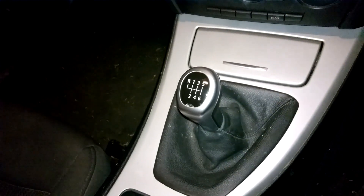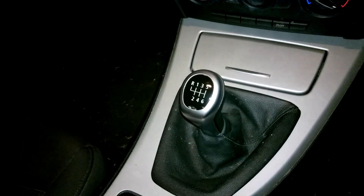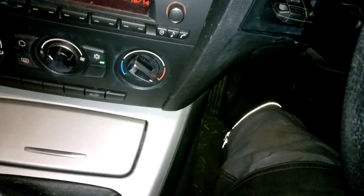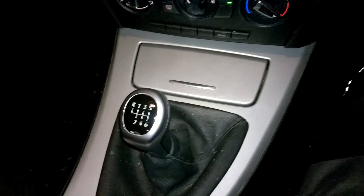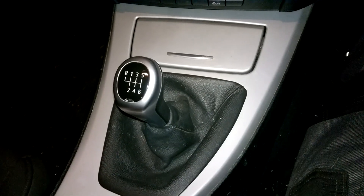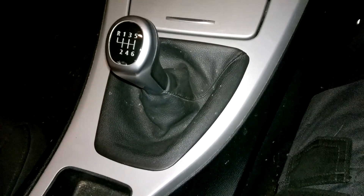I've just pulled in after carrying out a road test and this job is now complete — we have gears functioning as they should with no noise of any kind. As I was saying earlier, if you just look down at the clutch pedal area, when you lift up initially that is where you might get a vibration or rattly noise, especially in first or second gear. If you're having that complaint, there is a high possibility it's the same issue — the dual mass flywheel. In this case it was also struggling to get gears at times.